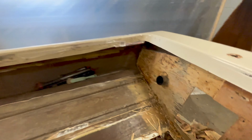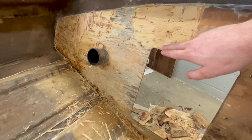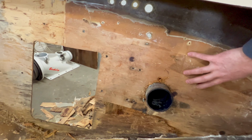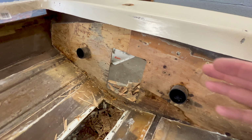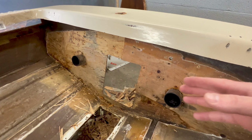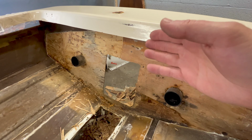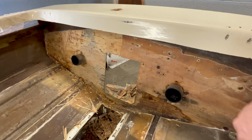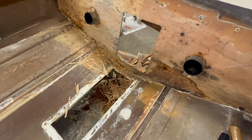Now for the wood, you can see that I have it down to the bare glass there. There's a little bit of wood that I can sand off, and I'm still working over there. This side's untouched. I've tried several methods, but what I've found has worked best is I take, again, the oscillating saw, which has been a great tool for this project, and slice a crisscross pattern into the wood. That allows me to take a standard chisel and hammer and knock it out in smaller sections.